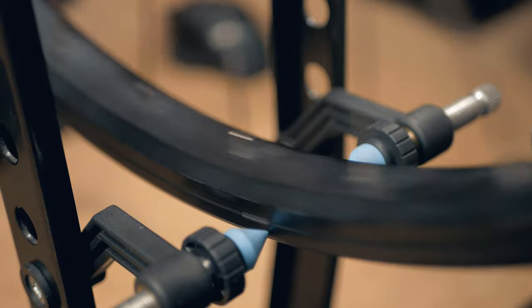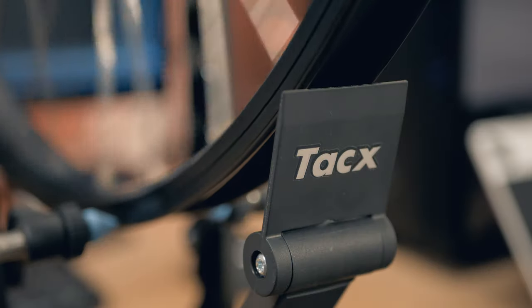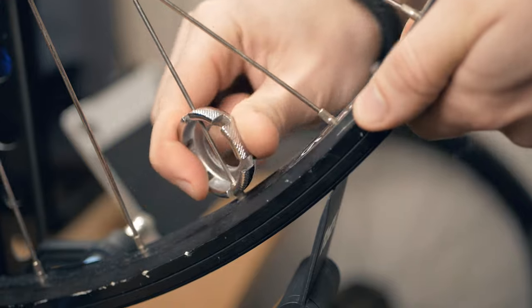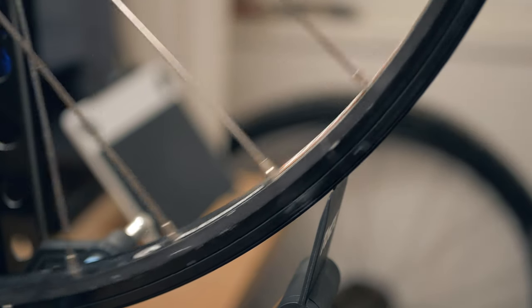After this, we'll see what this mysterious part of the tool is. This little flap simply helps us determine how round the wheel is, and we'll work on it by tightening or loosening two spokes at a time. In a while, even that will help us get the wheel back in its original form.